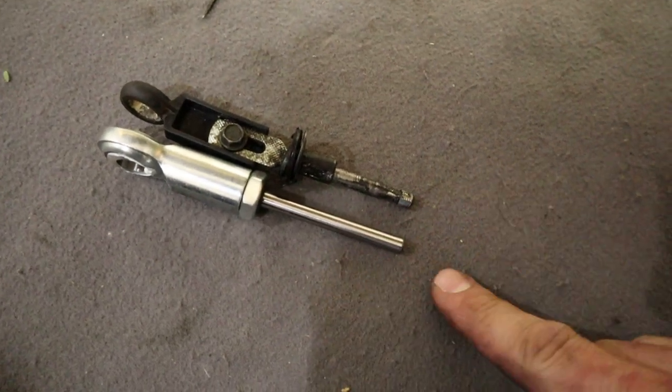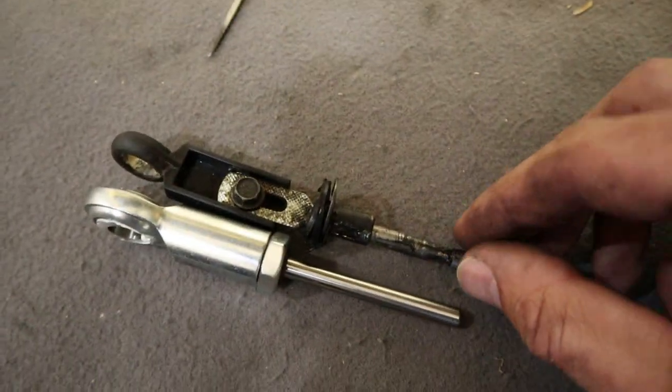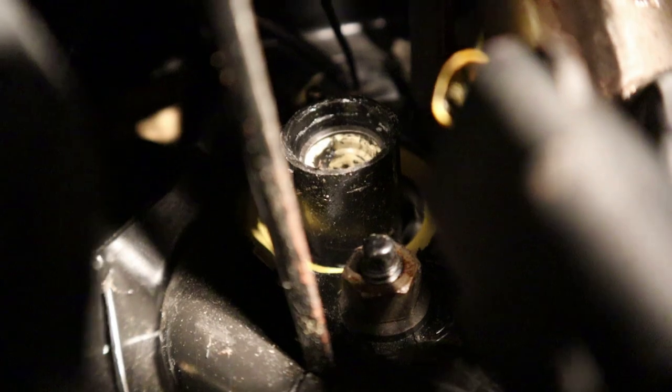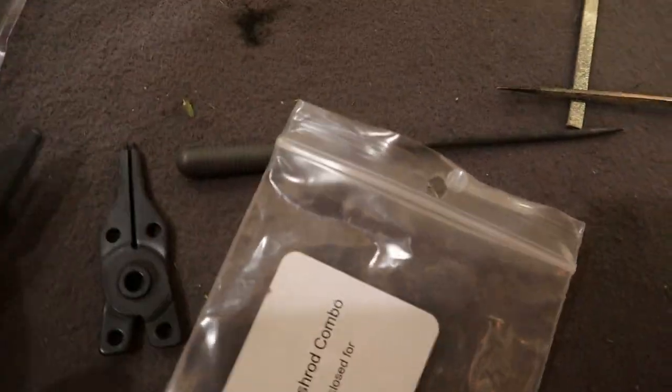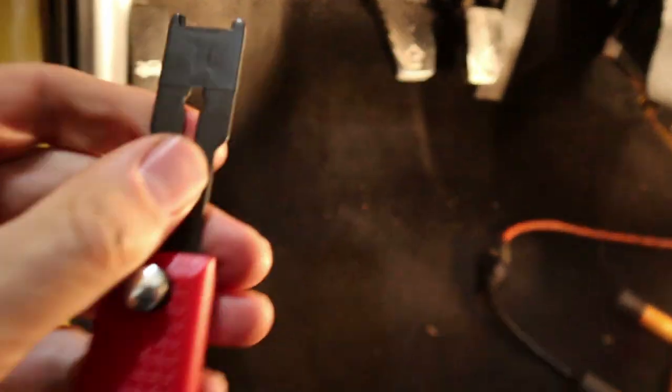Before I cut the old rod, I matched up the lengths — the new one is going to have to be a little bit longer, which is probably where some of our issues came from. The stock one kind of looks like a piece of junk compared to the DCR. Be super careful putting your snap ring back in — I dropped mine and it went under the carpet, had to pull panels and peel it back to find it. Use better snap ring pliers than mine. The E-clip that comes with the DCR push rod is about 9mm — I bought a kit recommended in another video. Hot tip: put a little black electrical tape on the tool to hold the E-clip when putting it up in there, otherwise it'll fall. It took a little bit of time, but she's all in and ready for a test.